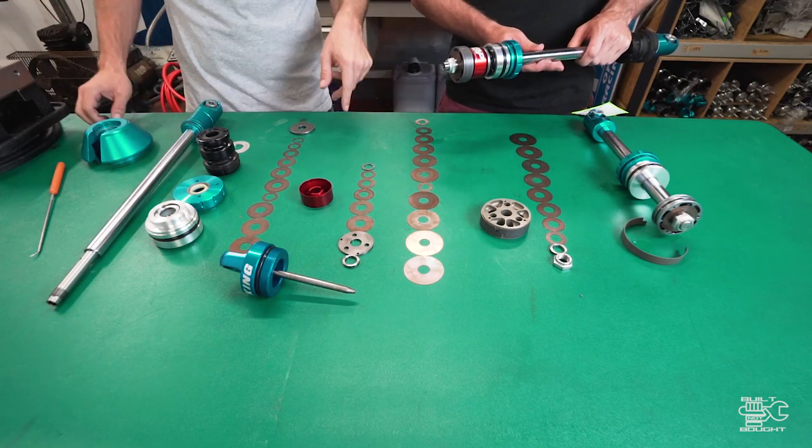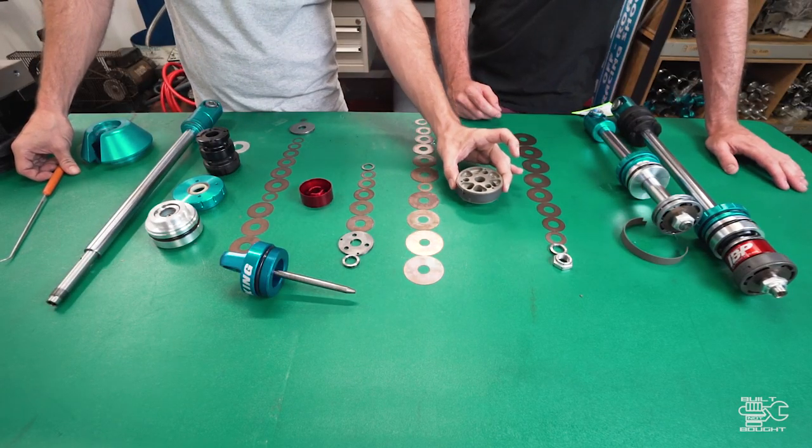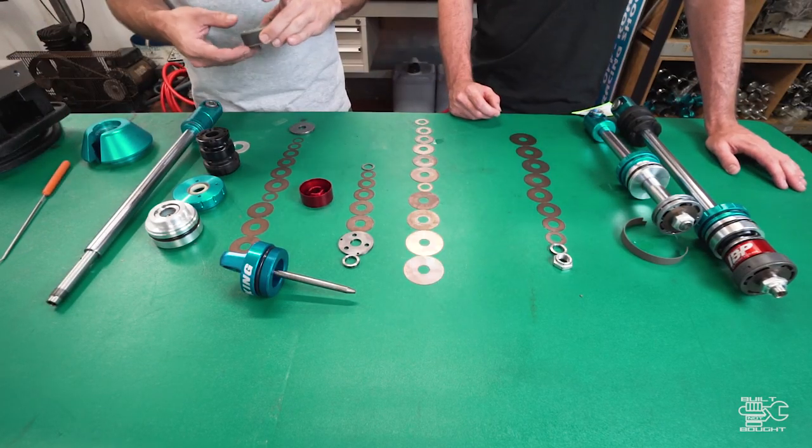This is a 2.5 and this is a 3.0. You'll hear people talking about 2.0, 2.5, 3.0 and so on - it's all just in the piston diameter. As you can see, 2.5 and 3.0, it's not much of a difference visually, but when you're looking at the actual surface area it's huge. Between a 2.0 and a 2.5 there's about 33% difference.